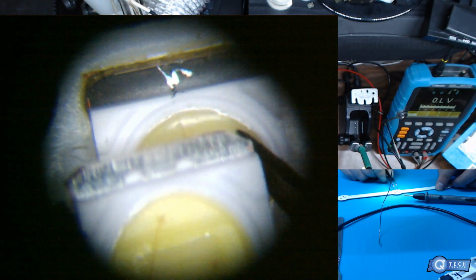Alright, so I want to put another LED here. I don't know if you guys can see the difference there. Alright, so I'm just going to point it out. This is basically charred here. Usually when these get really charred, they'll sit there and actually burn into the panel and cause a short. This isn't a short, that's good because they're all replaced. But it's actually burnt contacts in a sense. It's just overheating. This gets more power than the other strips.